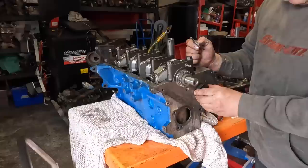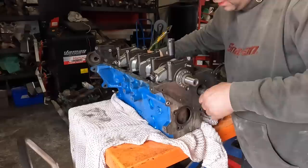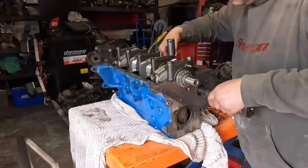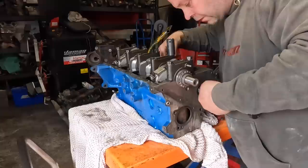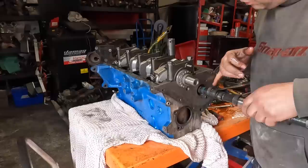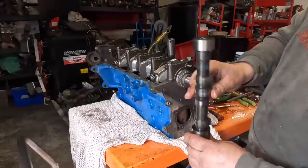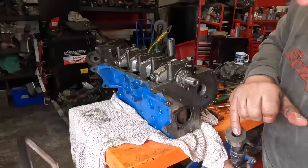This is also a thrust plate - you can see it's just wearing here, so that allows the cam to move slightly. I'm now very carefully taking the camshaft out, trying not to damage the camshaft bearings as it comes out. As I'm stripping this I'm looking at the camshaft bearings to make sure they're okay and don't need replacing. I'm having a look at the cam followers to make sure they're okay and keeping an eye on the cam as well. There are markings on the back to say who's ground it, but we'll have a measure up to make sure all the journals are okay. It does look in good condition, which is good.